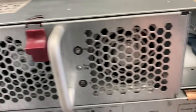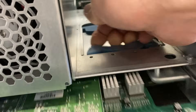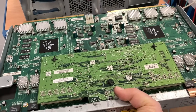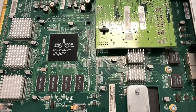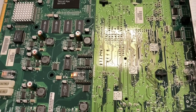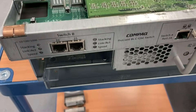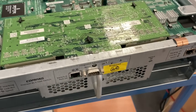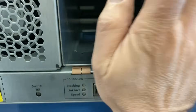Then we have a pretty interesting mechanism to release the switchboard. There is an Ethernet switch underneath here — in fact it's two independent Ethernet switches, switch A and switch B. They connect all the blades together on one side and provide two times two output connectors on the back side. Here you can see switch B, and that's switch A — two independent switches going to the blades attached on the front.